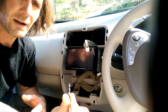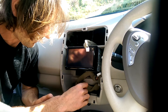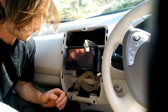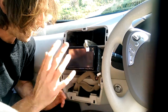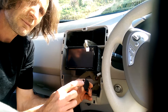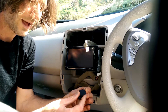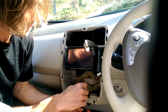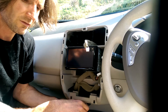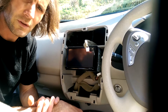If you know how to drill you probably don't need to hear this. Drill your pilot hole, then a bigger hole, then the correct final size — 20 millimeters. As you're drilling, be careful of the 12-volt connector; it's got a little flip cover on it. When I did it the first time I caught that with my drill, which is not a disaster but is a fail in terms of doing the job well. Be very careful not to let the drill go too far. If you're not confident, get someone who knows what they're doing with a drill to do this bit.